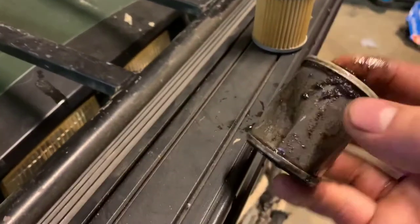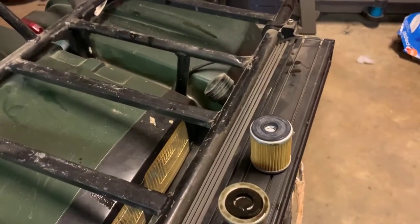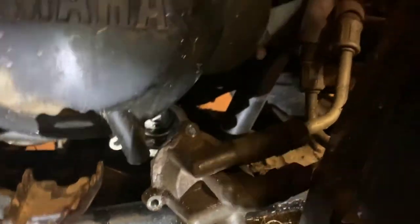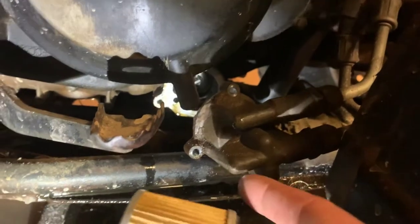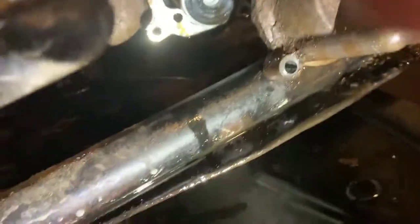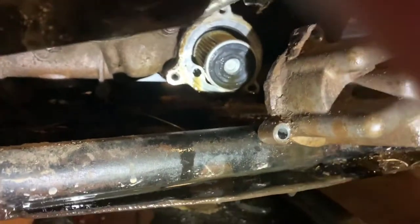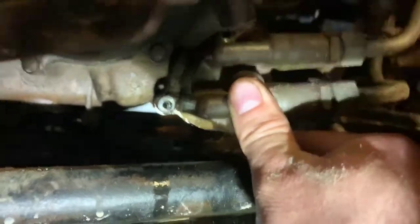This is just not good at all, so I'm going to let that drain for a little while to try to get as much gunk out of it as I can, but we're going to slide that new one in in just a minute. I went ahead and just wiped some of this crap out of here just because there's a whole bunch of little pieces of shrapnel and sand in it. To place it in there you're just going to kind of slide it on — there's going to be a little stud in there — and then you're going to put your plate on very carefully, and from there you're just going to put your bolts in and it should press that filter all the way in where it needs to be.